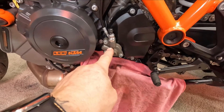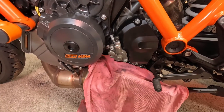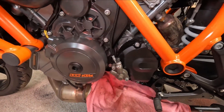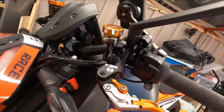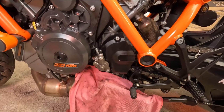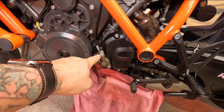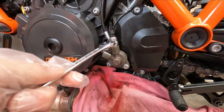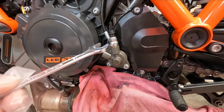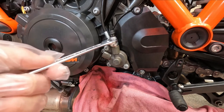So we're going to replace that. Looking at it at the moment, I don't believe we're going to have to take off the chain guard, but we'll just have to see. I'm going to leave the fluid in the master cylinder with it still done up because I'm hoping that it will cause a vacuum, so when I undo the banjo it will leak some fluid but won't drip straight out. Let's start with undoing the banjo — hopefully we're not going to lose too much fluid. I might be completely wrong on this; I'll probably have to completely drain the line but I'm hoping not to.